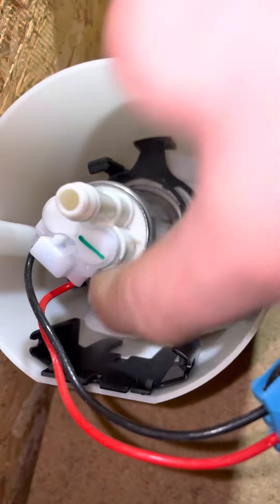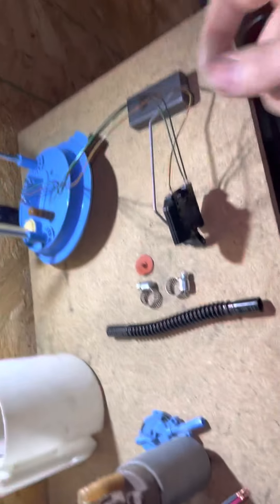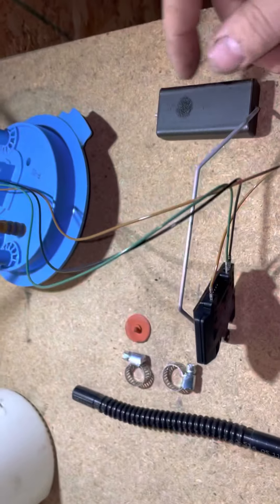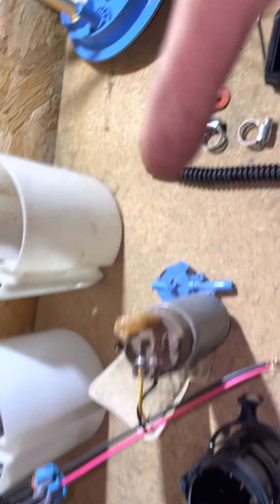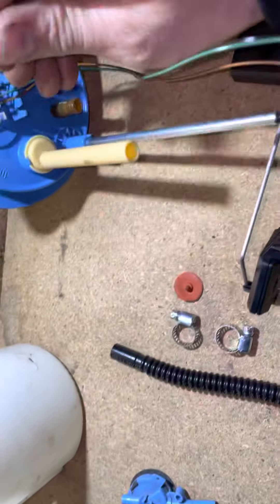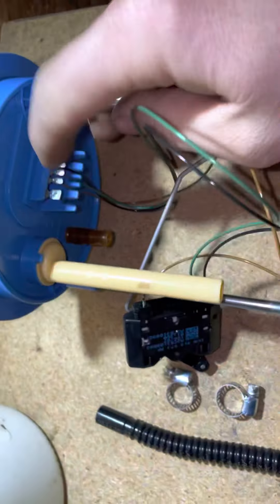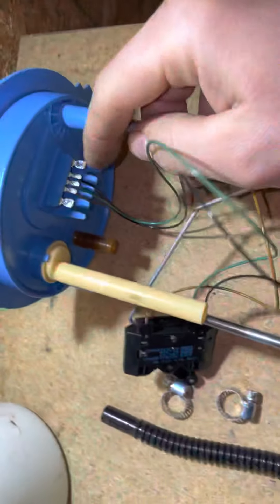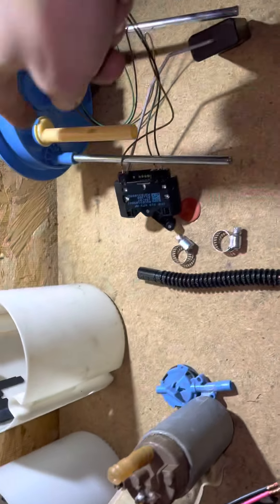Go ahead and drop your sock in there and click your pump on it. I dropped the sock through the biggest opening - just slid it in there, dropped the pump in there. Obviously you'll probably have your level sensor and top head off. You can either cut the black and blue wires - power and ground - and just crimp or solder. What I'm going to do is desolder the factory pin wires; the round side is positive and the flat side is negative. I'll clean up those holes and solder them back in for a cleaner connection.